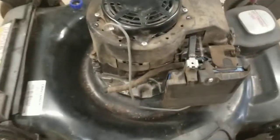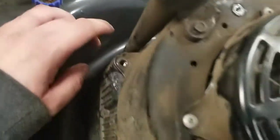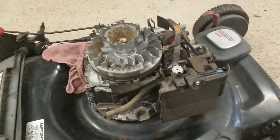The short plain ones go in the corner next to the muffler and the other corner where the side fuel tank bolt goes. If the longer bolts are in the wrong holes they won't tighten up properly. I took this time to clean off the area with a blow gun. The whole dipstick tube comes off along with the cowling. Give that a sharp little tug and it'll come right off. Then set the starter assembly aside and cover the opening with a clean rag so dirt can't fall inside the engine.